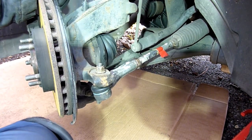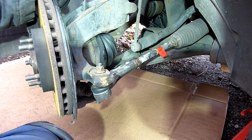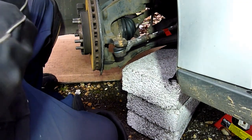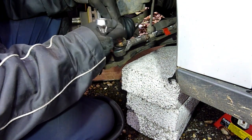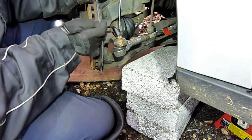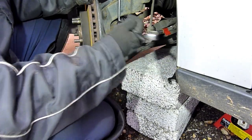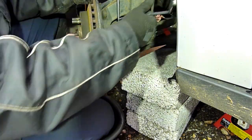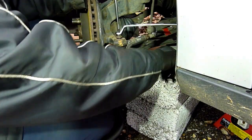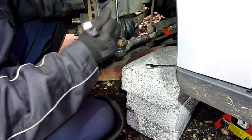Turn the steering. Load up some 20kg blocks or bricks — it's nearly all the way to the top. Take this off — 15mm spanner, 4mm allen key. It should come off; I haven't driven it or anything. To get that tracking arm off I heated that nut and that helped. I found it difficult to grip onto this with mole grips and stop it rotating. In the end I just used a 15mm spanner wedged on something solid — that's all I did.